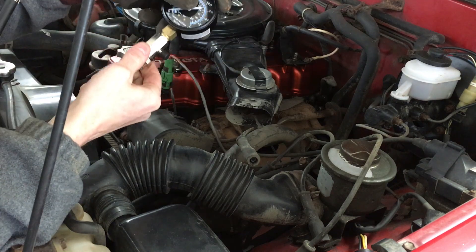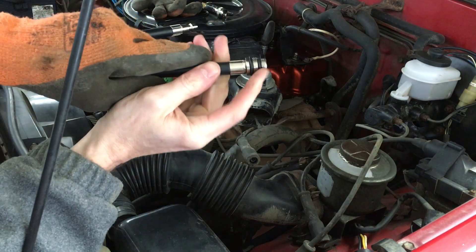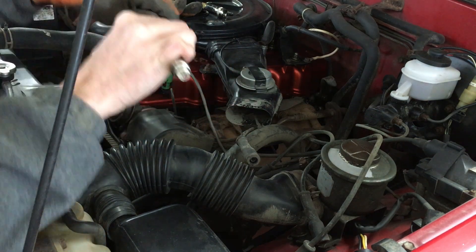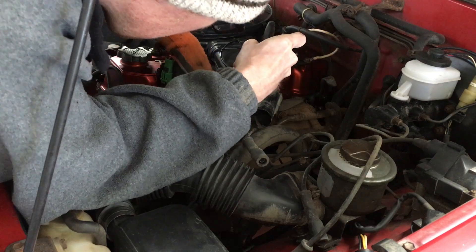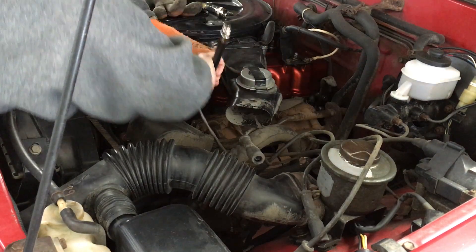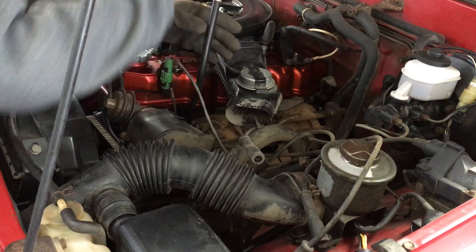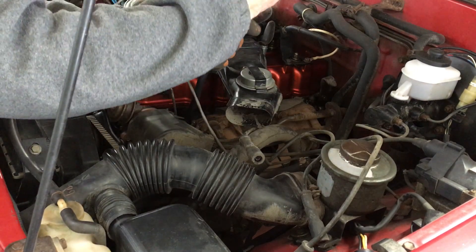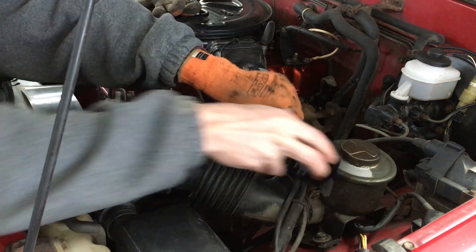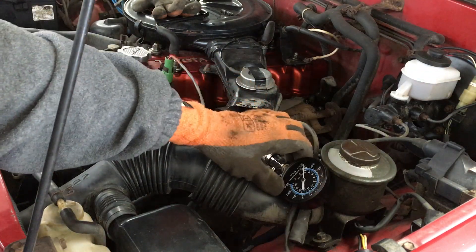I'm going to take the hose off from the gauge to make it less cumbersome to thread into the head. This hose has 2 thread sizes. Just be sure to tighten it gently at first to avoid cross threading and damaging the threads, especially on an aluminum head like this one. Once tight, attach the gauge with the quick release. I'll set this here where you can watch the needle move with each compression stroke of the cylinder.